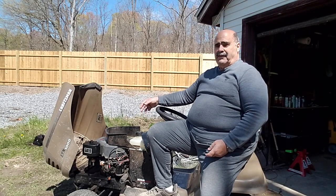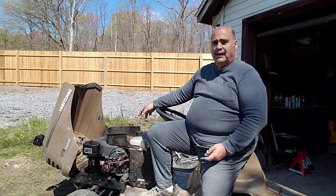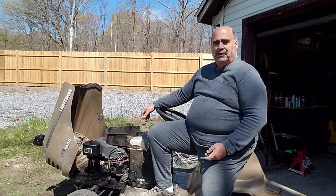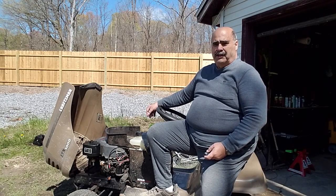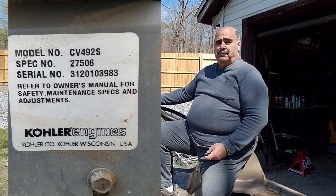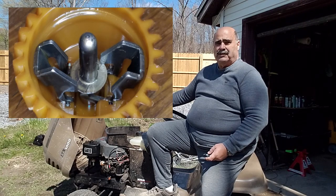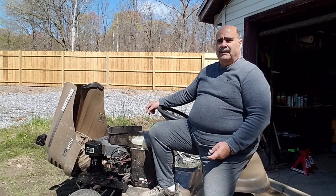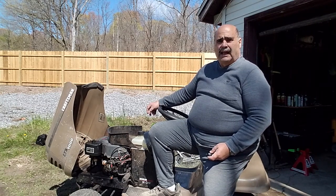I've never changed one of these — I've never had it apart. I've taken car engines apart, Volkswagens, Chevy engines, but I've never taken a small engine like a Kohler apart. Like many people do, I looked on YouTube to see others who have done similar work on similar engines. This is a Kohler CV492S. The serial number indicates it was manufactured in 2001, and unfortunately it has the plastic governor gear that seems to be a common issue — the gear either fails or the cap that connects to the governor rod pops off, and then there's no speed control on the engine.